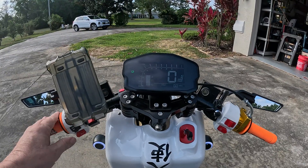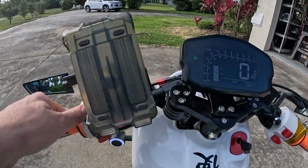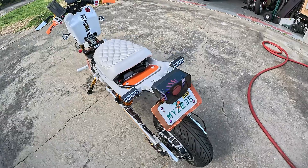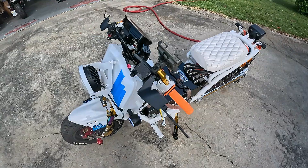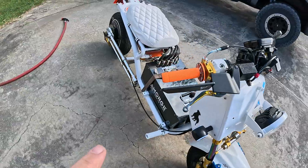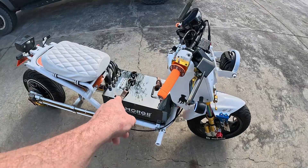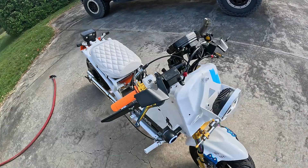All the stuff that used to be on your bike when it was a gas bike — like the blinkers, left and right, headlight, horn, tail light, brake light — all this kind of stuff is going to stay. The wiring harness is going to be the same, but we've got to get 12 volts to it. We're going to get that 12 volts off the big battery — we're not going to have a little battery in here anymore. That's gone, so we're going to convert that 96-volt battery into 12 volts.